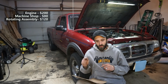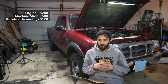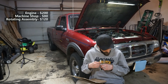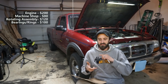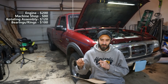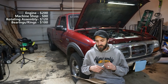I also bought a kit with all the bearings and piston rings for $100. Unfortunately I didn't use the rings — I used all the bearings but not the rings, because the ring thickness was a little different. I measured with a micrometer and the sizes are different, so I couldn't use them. I now have a complete set of Gen 3 piston rings I'm not using.